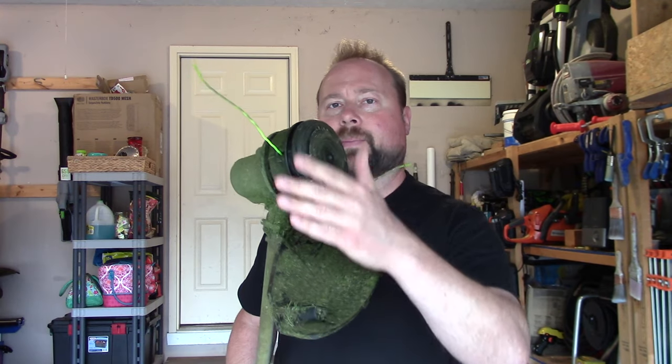Where do you tap it on the ground? I prefer doing it on smooth surfaces. If you hit it on really rough concrete or asphalt that works like sandpaper, you're really going to chew up your bump head and it's going to destroy the bottom. So I try to find smooth rocks, sometimes even manhole covers, or the side of a wood fence — give it a tap on there. Even in the grass, I just smack it in the grass; it really doesn't make a circle hole in the grass unless your grass is super great.